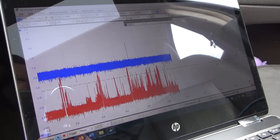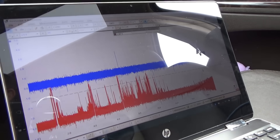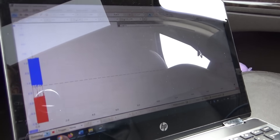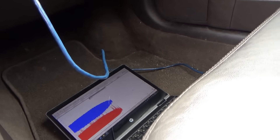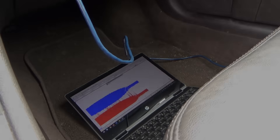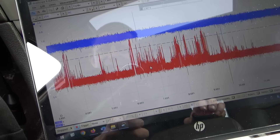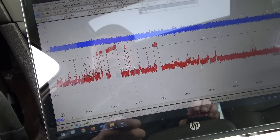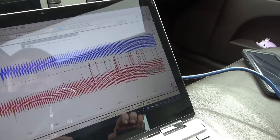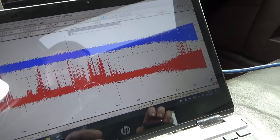It's not setting a code yet. As we start rolling the signals get bigger because we're rolling faster — that's a cool capture. When we're standing still and just turning the steering wheel left and right, there are definite dropouts, some big ones especially. Then we started moving and there are more dropouts — boom, boom, boom. It has to be a broken wire. We need to take off the right front wheel.